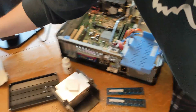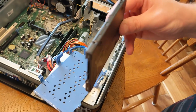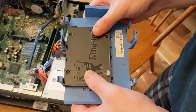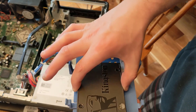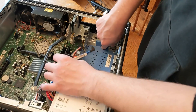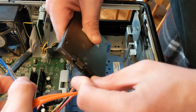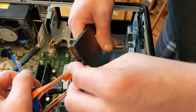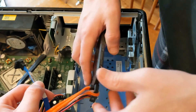Hard drive is out. Now we're gonna put the solid state drive in. Here we have our Kingston SSD — you can see these holes right here. I assumed one lines up, but since we don't have an adapter, we're gonna use double-sided tape to slide it in the drive bay. Drop the bay back in, push it forward, and it locks in.